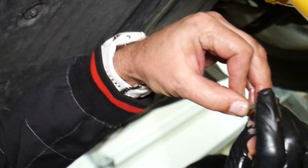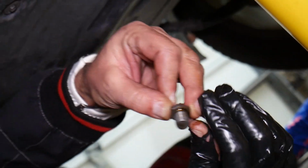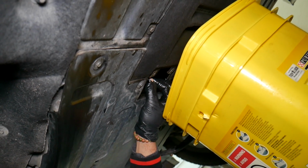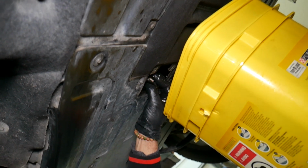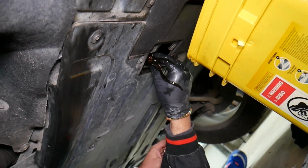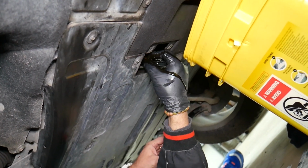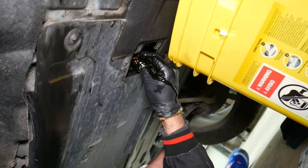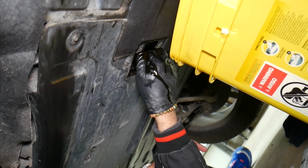So we'll go now under the car. Practically it's barely dripping, so this is practically drained, guys. We'll get the drain plug now and we'll go ahead and change the washer on it, install the new one, the new copper washer, and we can go ahead and tighten it now. Hopefully we don't drop it in the bucket and we'll start dripping in a little bit. Okay, having a hard time installing it there because it's quite slippery, guys. So make sure you align it and start it by hand.